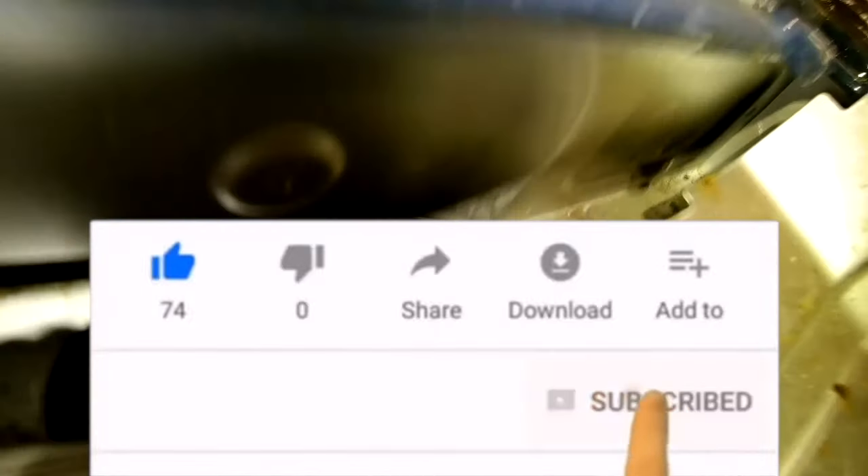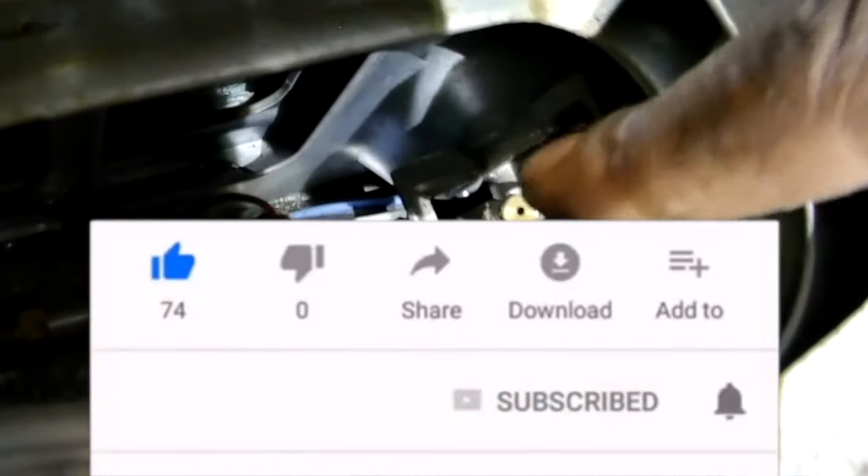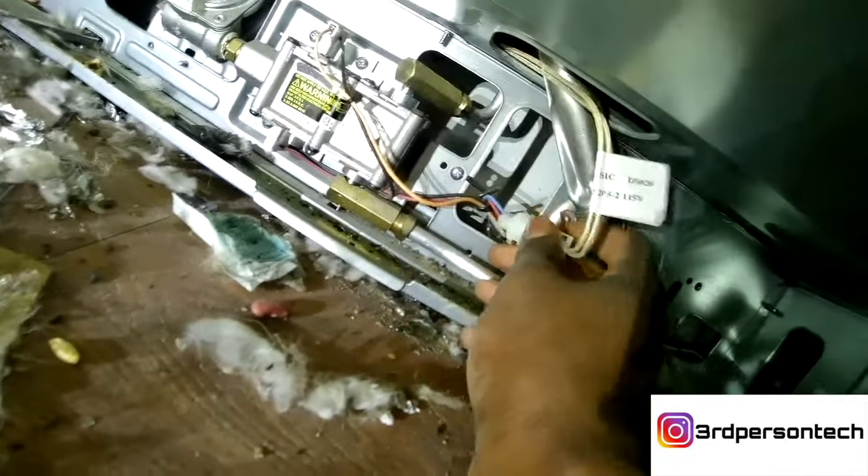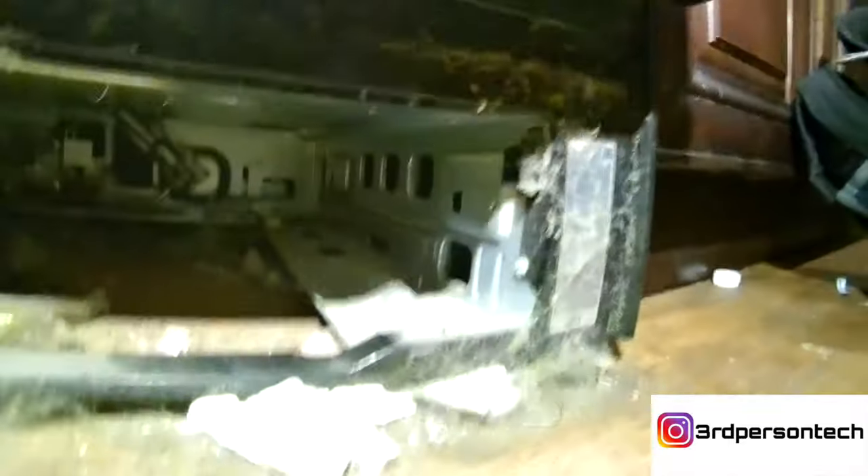If you look at that burner valve, this is where you're gonna stick the burner tube — it sits on top and slides right into it. First, snake the cord back into its creases, then line up the burner tube on top of the burner valve. This is very important because you're dealing with gas here, so you want to be careful. As soon as you line the tube up, put those screws back in. Then we're gonna fish the igniter back into its slot and plug it in.